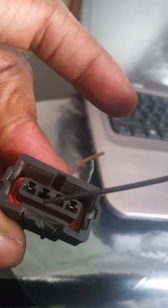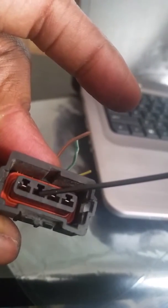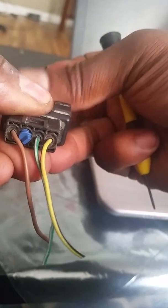What I have is you can take the wire you took from the connector, straighten it, and push through. But I chose to use something else just in case I have to reuse this wire. I'm going to go through the front of the connector — there's nothing there — so you can push straight through and push that plug out. Watch the plug fall out right there. Plug out. Done.